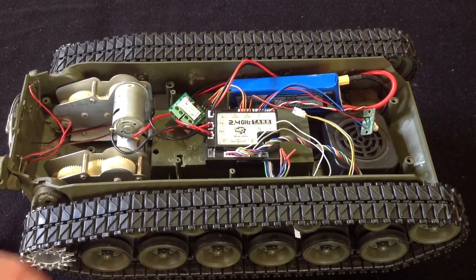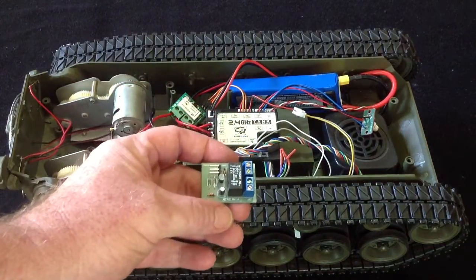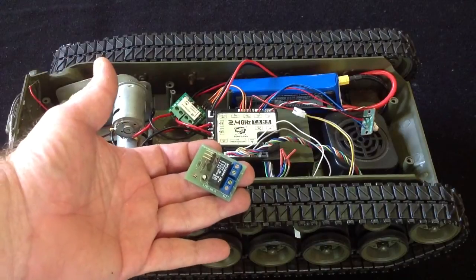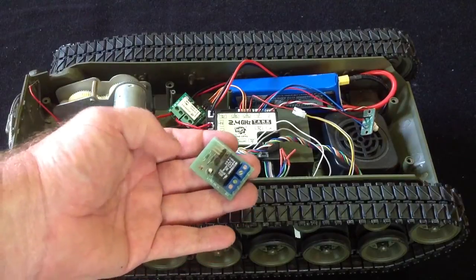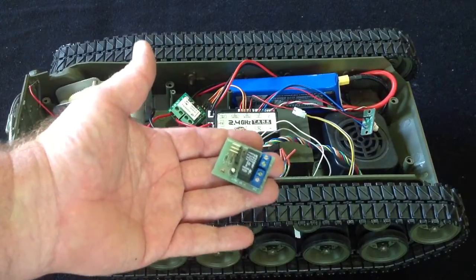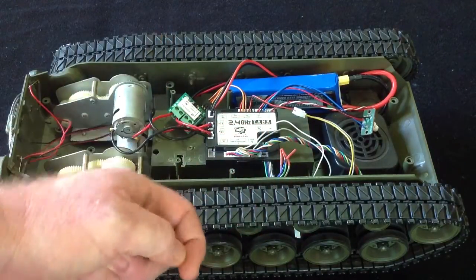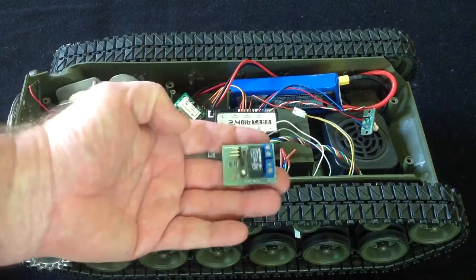Hey everyone, in this video I want to talk about the return of a classic. This is my old ATARC board — one of the very first ones we used to sell in the shop. They're years old now. This is what you used to use to stop your anti-track recoil. You used to have to solder some wires onto the bottom of your RX-18, and that would stop your recoil. A lot of people didn't like this because they were scared of soldering, especially the fiddly soldering underneath the RX-18. So from that, the Dragon and Komodo were developed with solder-free track removal.